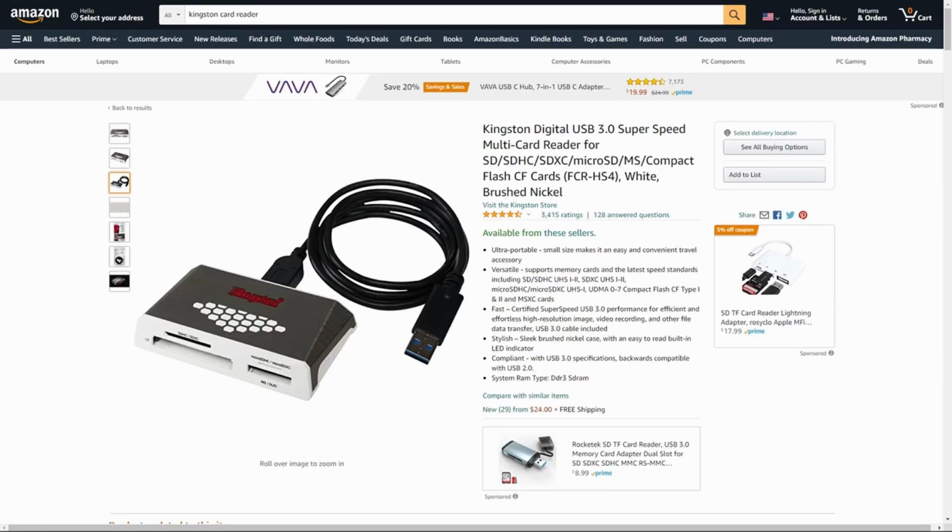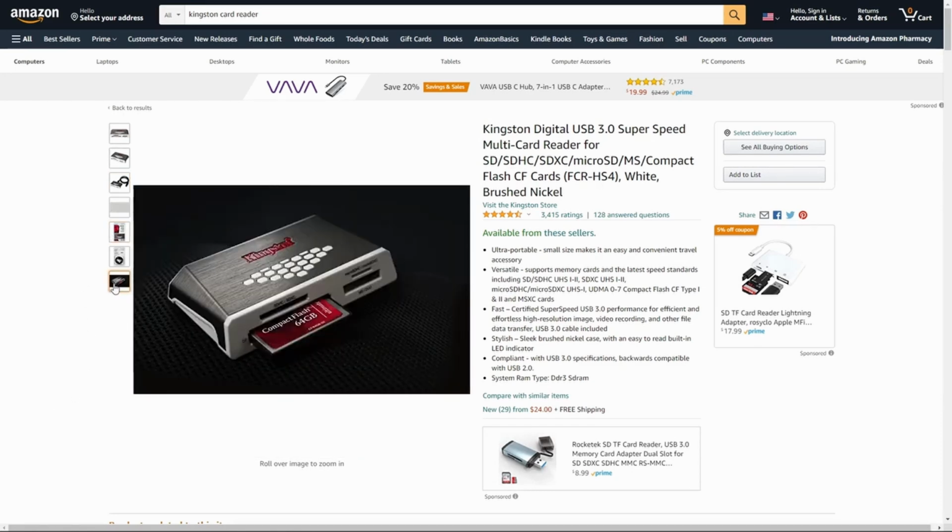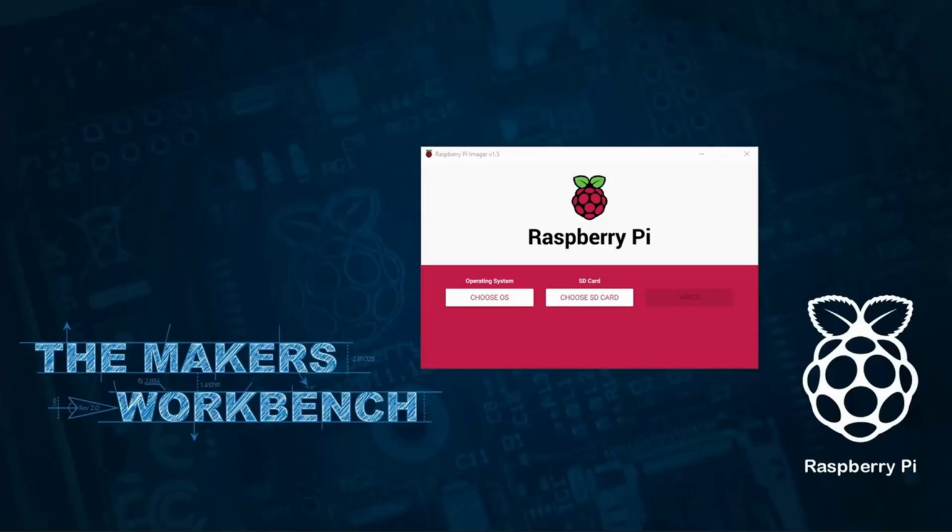You'll also need some way to read and write to the SD card you're using, so if your computer has a built-in SD card reader, you're good to go. If not, I've left a link in the description to the one I use myself. It's great and it's worked for me for years. Once Raspberry Pi Imager has downloaded, install it as you would any other program, then insert the SD card into the reader and open Raspberry Pi Imager.